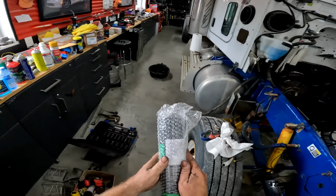Battery died. Oh, guys, I got the transmission done up. I got the transmission bolted in. You'll see no jack under there. There's no chain. I also got the clutch done up. I'm really, really glad I did it this way, because being that there's no cylinders in it for rotating the engine over to do up the bolts and the clutch, it was really easy. My torque tool is right down there. The nice thing was I could turn it, and once I got one started, the rest were a breeze. It took me a little bit to get the first one started. It's always a little tricky, but yeah, so happy. Clutch is done up. Transmission is done up to the engine. My front motor mounts line up perfectly.